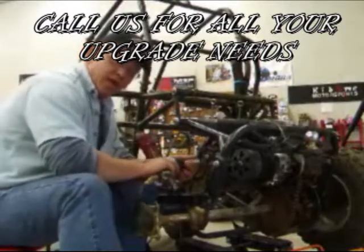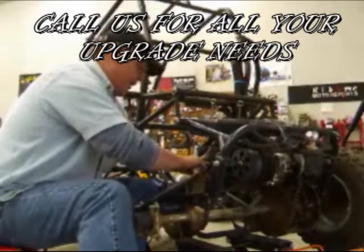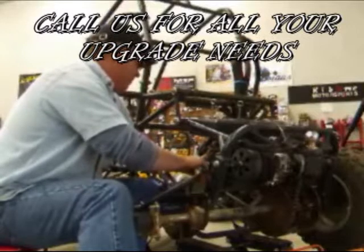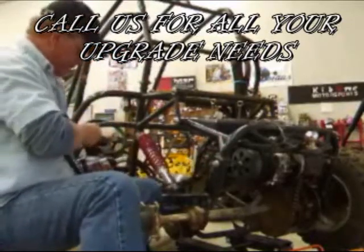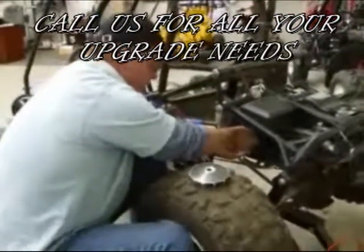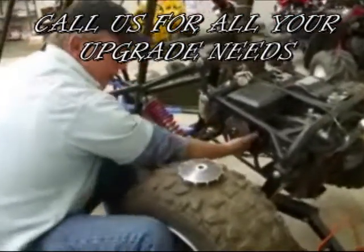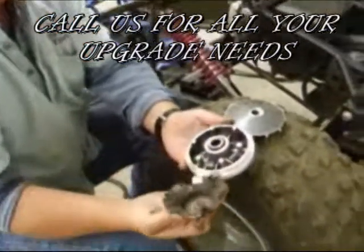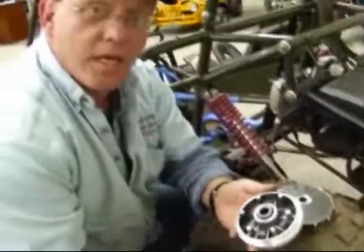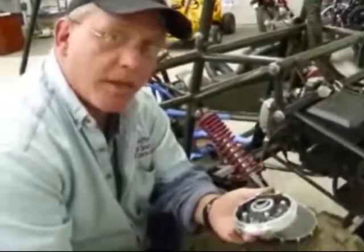First thing you do is take off the variator fan. In order to do this, you'll need an impact wrench and you'll have to hold the fan. Some of these you might have to wear a glove — they can be really tight from the factory. Take the belt off and lay that to the side. Then slide the boss pin and the whole variator out. Hold this together as you pull it out because there's your backing plate and your rollers inside. Now we want to weigh these rollers and see what weight we've got. We're going to drop one or two grams to give them a little bit more low-end torque. They don't want to sacrifice any of the top end, so we're only going to drop about two grams.